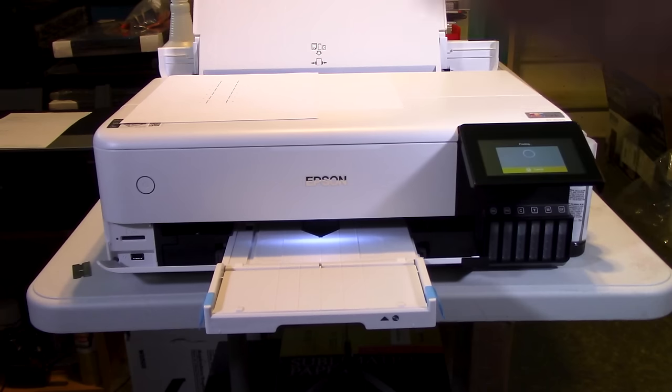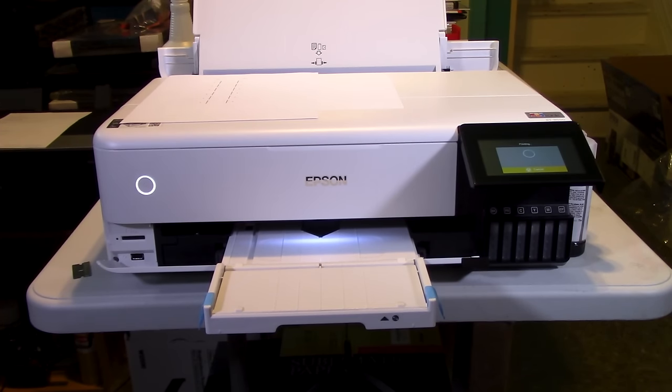If this was a professional photo printing unit, it would do this automatically for you. But what this does is, well, it will prevent banding, which is, you know, something you really do not want. And it'll be banding not due to a nozzle problem. It'll just be a mismatch between the width of the ink pass and the width of the paper advance. When the paper advances more, you'll get a gap. When the paper advances a little bit less, you will get an overlap. So you can get a dark banding or you can get a light banding.